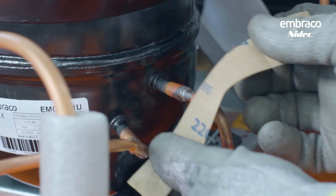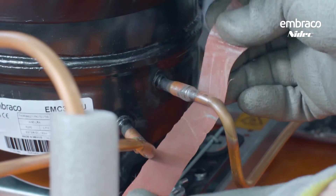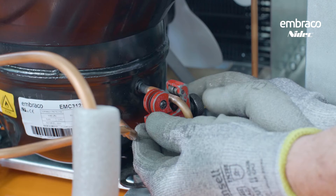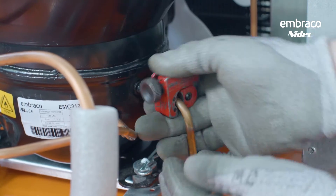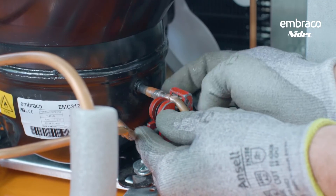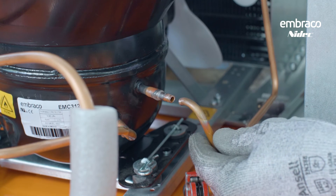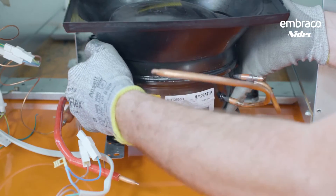Sand the original tubes of the compressor to facilitate brazing — sand where they're soldered in areas close to the compressor. After sanding, cut the discharge and suction tubes, leaving about 1 inch (20 to 30 mm) from the end of the process tube. It is not recommended to un-solder the tubes since there could be a clog in the cap tube or filter dryer. With R290, it's definitely preferred to cut the tubes. Once the tubes are cut, the compressor can be removed. We cannot reuse the same filter because the desiccant material can absorb moisture only once.